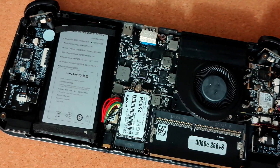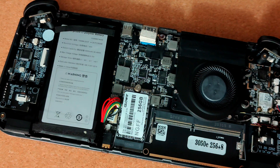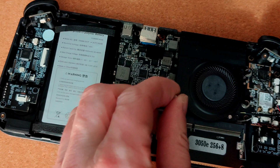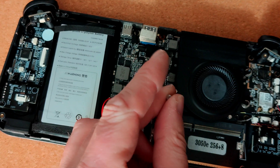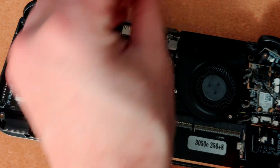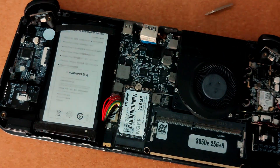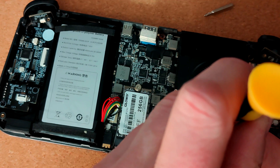Removing the M2 uses just a standard little Phillips. We'll start with the fan first, and I'll make a little mistake here: see these two little silver screws? Just ignore them - you don't have to take them out. Make sure you've got a screw bit that fits snugly in the hole; you don't want something too loose as you risk destroying the thread or stripping the screw head. I've got two different sizes for the different screws. Learn from my errors: leave those two little silver screws in, you don't need to remove them.